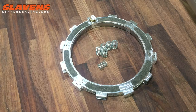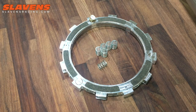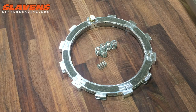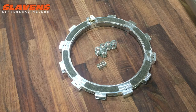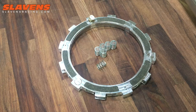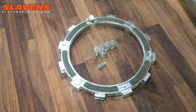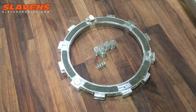This video is about our Slavens Mule Recluse Clutch Tuning Kit. The whole purpose of this kit is to change the engagement point and disengagement point of the clutch. I came up with this because I've got a 17 500 KTM, and the clutch setup from Recluse for that bike was horrible. Even with the lowest engagement springs, the thing freewheeled anytime I pointed it downhill.